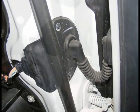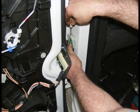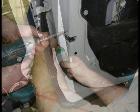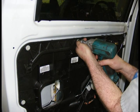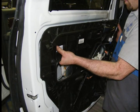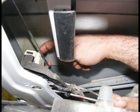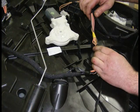Remove the two screws that hold the wiring harness to the door. Remove and disconnect the wiring plug at the B pillar. Now remove the three door latch screws, the inner door panel bolts, and window regulator assembly panel. As the panel is being removed, disconnect the lock rod from the door latch. The window regulator assembly panel is now removed. Remove the wiring harness from the window assembly.